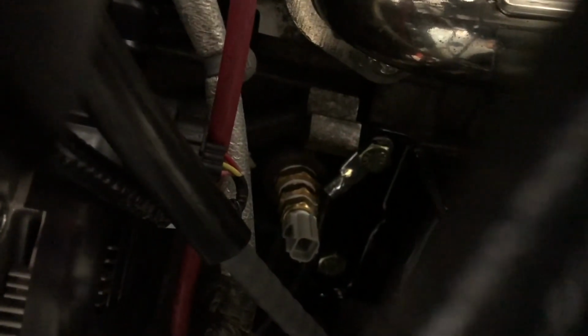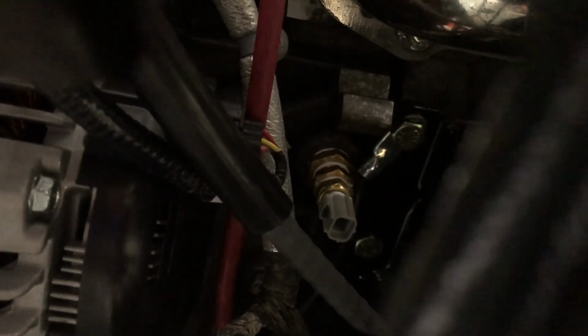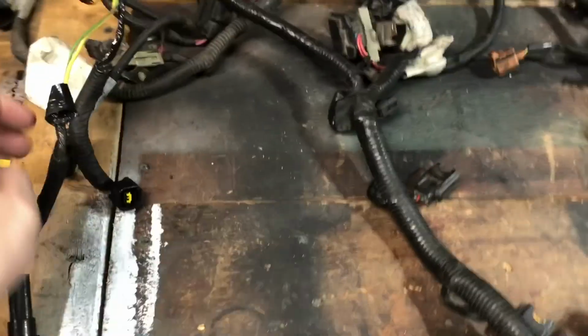on the side of the block. Let me see if I can even, right up in there, you can see, right by the motor mount. So right by the motor mount, I've got I think it's a 3/4 to a 3/8 NPT adapter in the block, and then I've got a 3/8 to a half, which the sensor is a half. I just got that off Amazon. Just a generic coolant temp sensor with 2 little pigtails. So that's probably gonna get one of these coolant temp sensors.